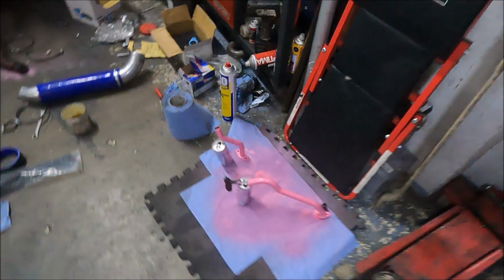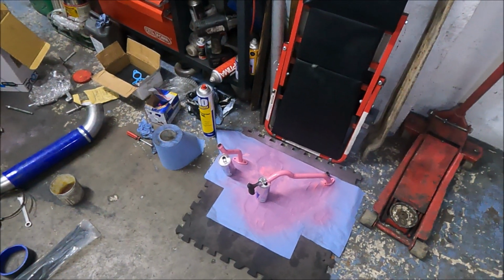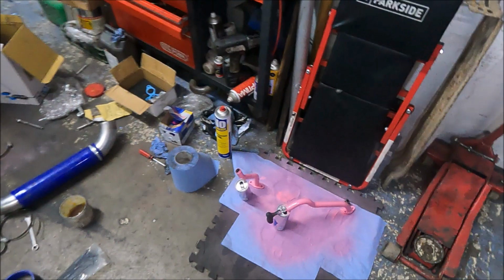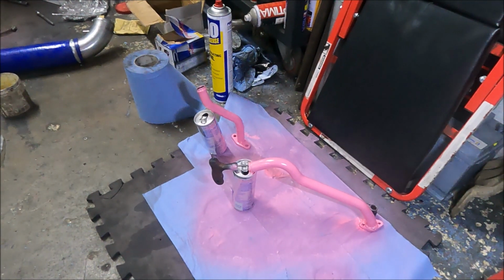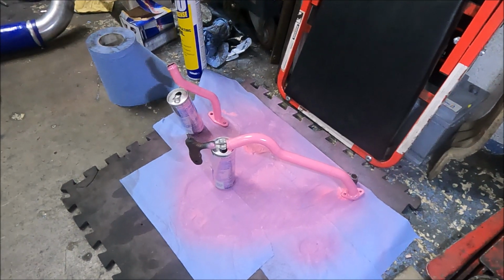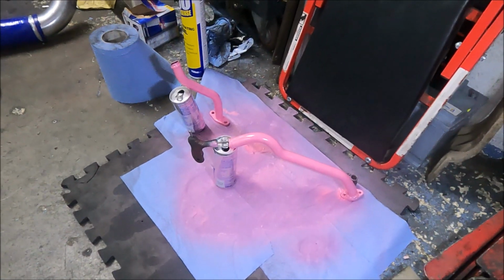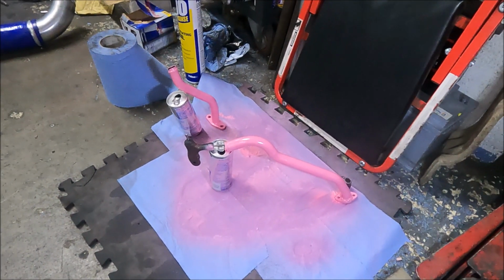They are made from lots of other pipes. Literally, some of it could be from the 1980s. They're made from about 4 or 5 different commercial lorry oil return pipes. Basically, over the years, because I know that most of these aftermarket oil return setups are fucking shit and way too small, and who does it better? OEM. Then when I've picked up used lorry turbos, if they happened to have an oil return fitted to them, I kept them. And because I know they're the right size, because OEM aren't fucking stupid.